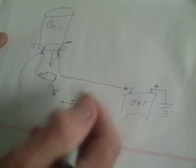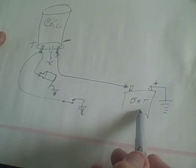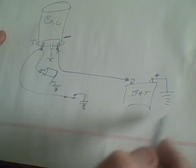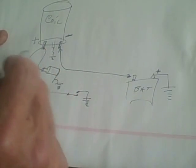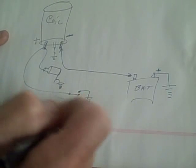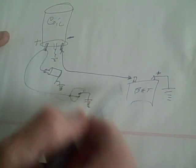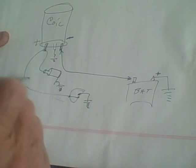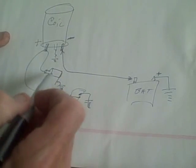As a review, this is the setup you need. You can do it with the battery on the car, or you can use a battery charger or some power supply. The positive is grounded — I grounded mine to the vise, or you can ground it to the car frame or whatever. Then the negative terminal goes up to the negative terminal on the coil. Then the positive terminal on the coil has to hit ground and then break in order to cause the spark. Here are the points — or I was just touching this terminal to the vise to act as points. The condenser has to go somewhere in this circuit to ground, and in the distributor it's hooked near the points to ground. You can also hook it to this terminal to ground, but you need a condenser.